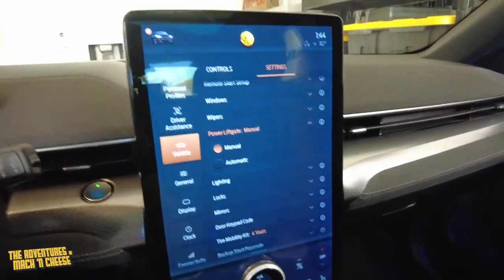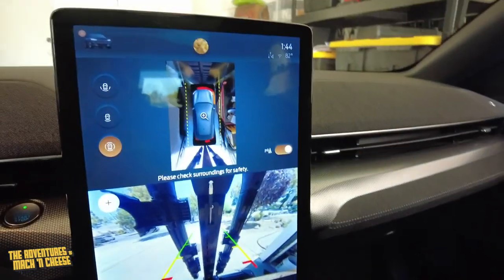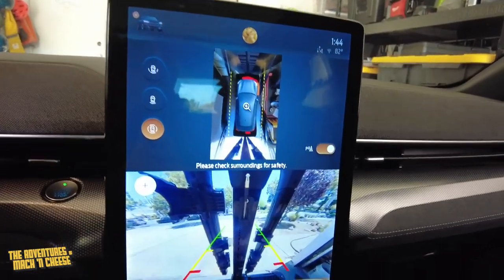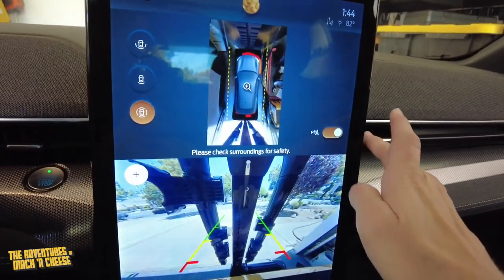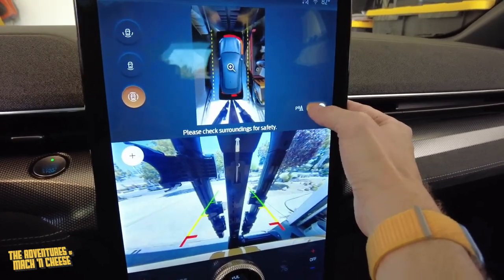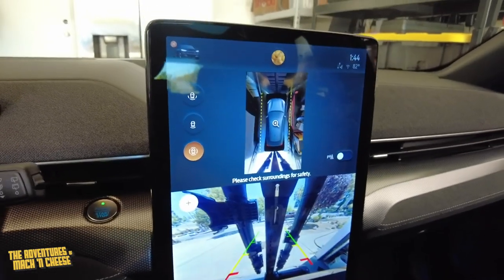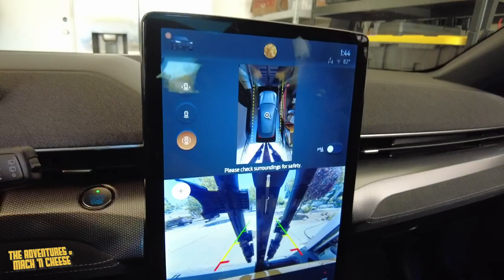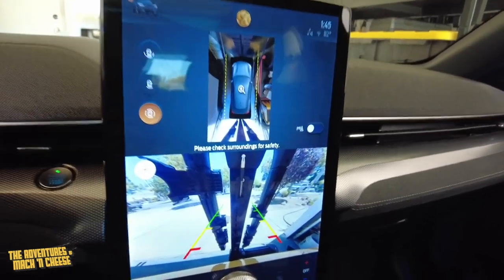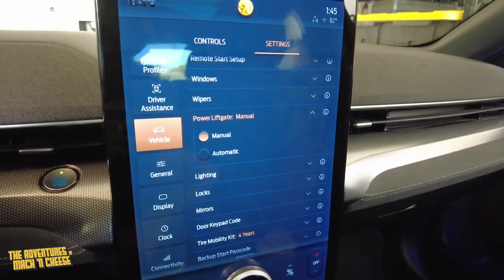All right, the second thing you're going to have to do is when you actually put the car into reverse, like you see here, you will hear this, which is telling you, hey, there's something right behind you. I can't go back. Don't do that. So what you got to do each time you go back is turn this off. I think it might be each time you back up, or probably more likely it's each time you turn on the car. But you have to turn off this park assist. You'll get a warning saying that reverse brake assist isn't available, meaning if there's something behind you, like a kid or another car, it's not going to stop your car, but it is going to prevent that awful noise from going off all the time. I don't think that the reverse brake assist is going to work anyway, because it's always detecting that there's something in front of the parking sensors. So that's the second thing you have to do when you got this thing on the back.